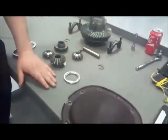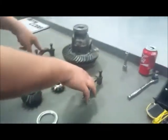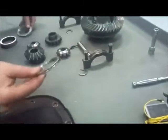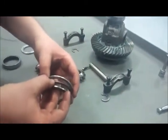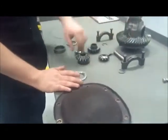Holding our carrier bearings to the axle, we will actually have two carrier bearing caps. And on each, right up under each cap on each side of this carrier, we'll have two sets of shims — multiple shims per side. They're very fine. They pretty much keep the carrier locked together and don't let it move anywhere, and they also set our backlash on our pinion.